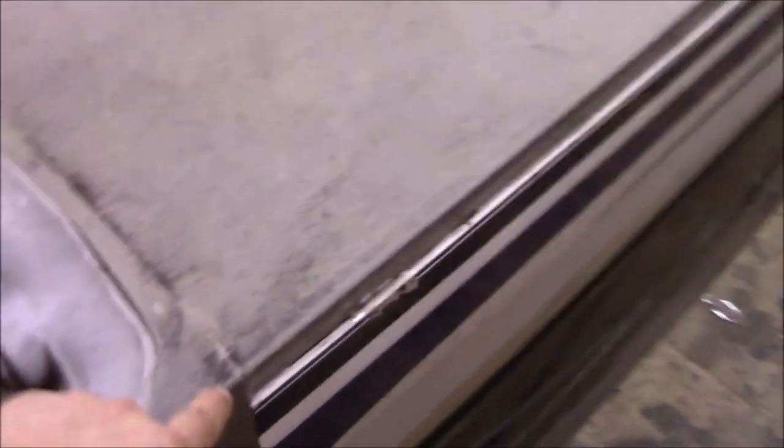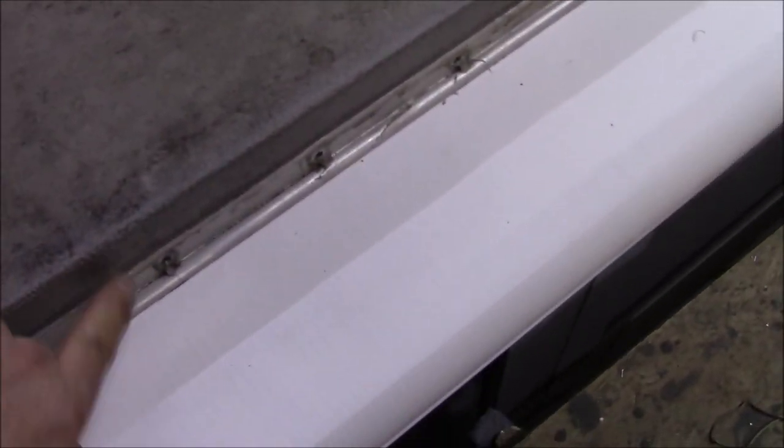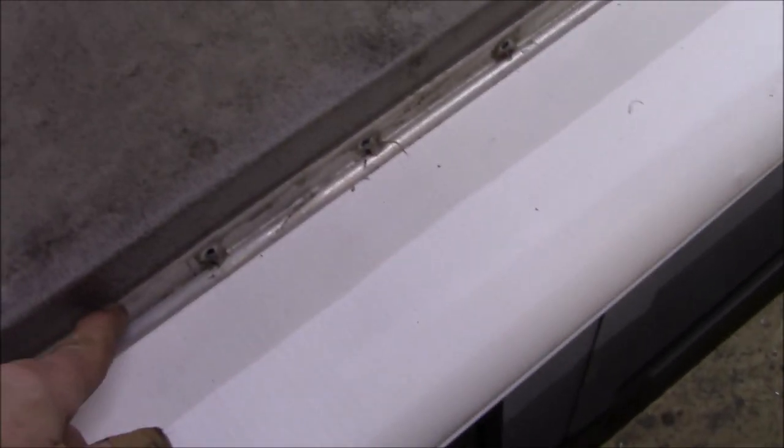This coach doesn't have any gutters and I need to get gutters on there. On the other side, no gutters either — that's odd. All that water is just going to drool down and ruin your decals and everything else. You also want to check your awnings — sometimes you'll see little tears or rips inside there. This awning is going to have to come off anyway because we need to get up underneath here and see what's going on to get a gutter on there. I also want to go around these lights — I want to make sure the customer doesn't have little leaks coming from lights or around the windows.